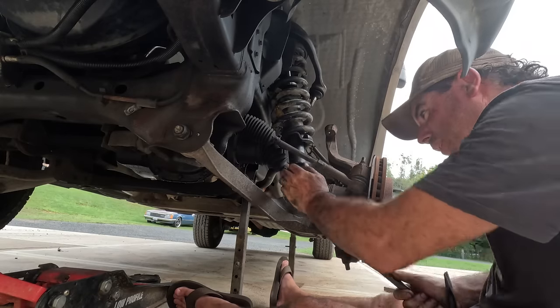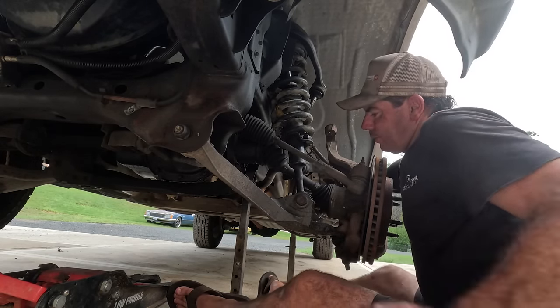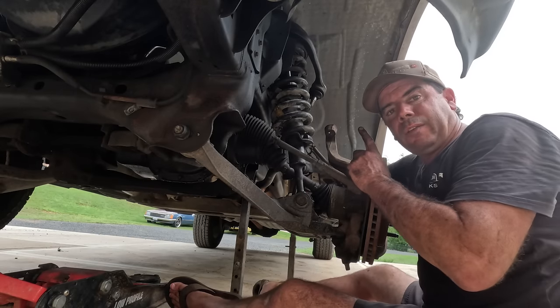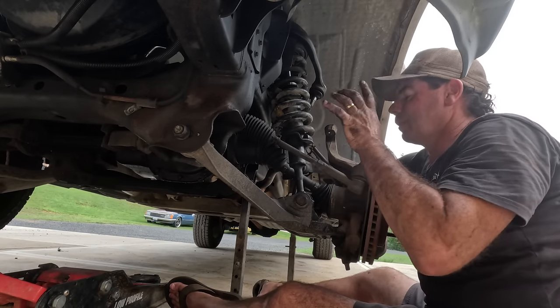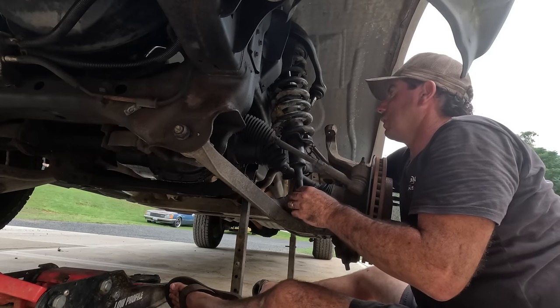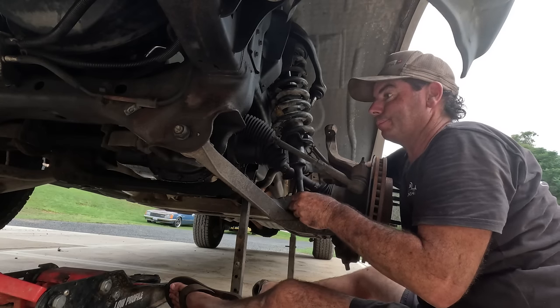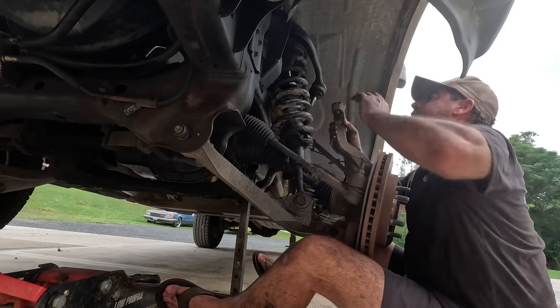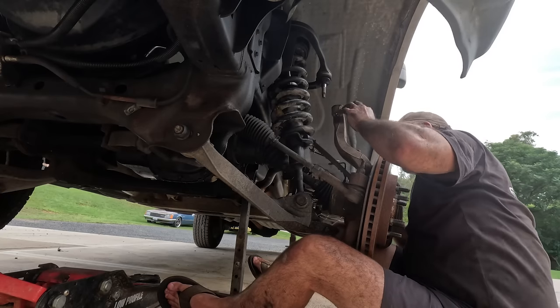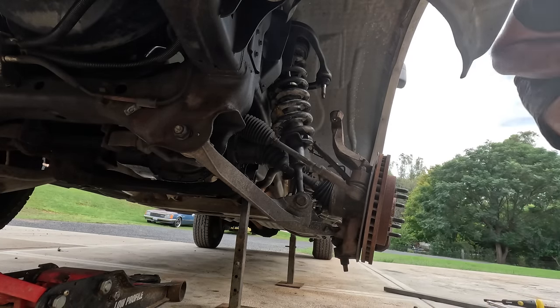So there's our strut bolt in. A strut nut on. And those bolts up the top there, they're just on finger tight, but you can do them up after. So I'll get that guy nipped up. We'll do this top ball joint up and then just start tightening things back up. I have to get the jack and jack that one into it, I think. All right, nearly there.